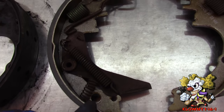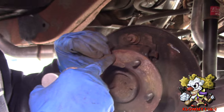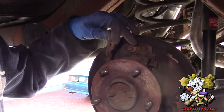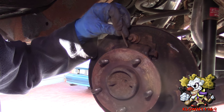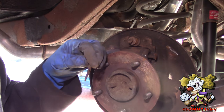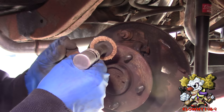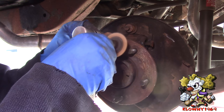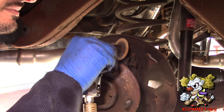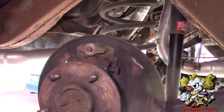One thing before I put the shoe on — I like to clean this over here. You could use a little bit of sandpaper; I'm just going to use a scotch brite pad here. I'm going to clean this so when the retainer is on, we have enough space to put the springs on and they seat nicely. I also have a video on how to change this wheel cylinder — I have the link in the description below. Now this sits nicely over there and it's nice and flush in the back.